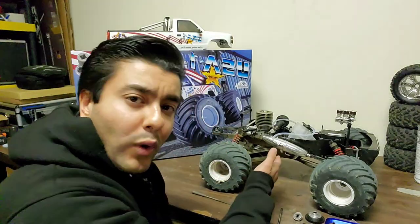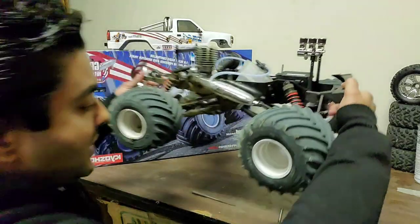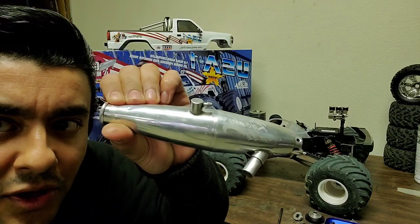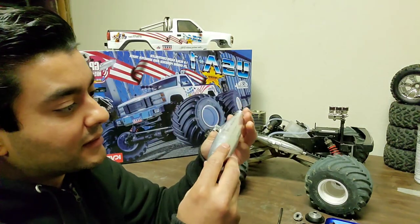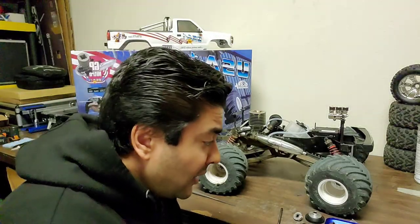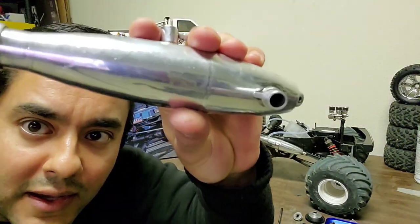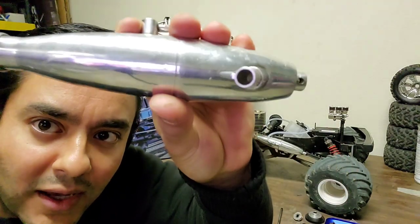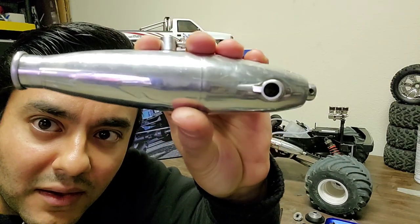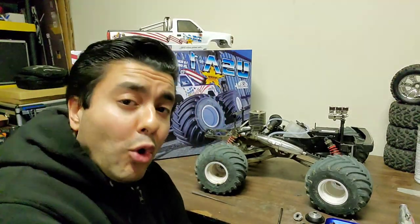Personally this thing is way more polished and good looking. To compare it with this Kyosho one — this is pretty much how it came out of the box, a bunch of scratches on it, not exactly polished like they advertise. And then worse obviously the baffling came loose and I didn't even crash — I was just driving around and suddenly it happened, just dislodged itself. If you look down in that hole right now you can see the exhaust port is open. If I shake it back down and look in there, it's closed — something is closing it off. That's the baffling inside. Such a head scratcher, and when I figured it out it was a big relief.